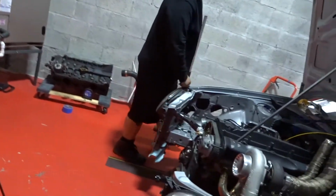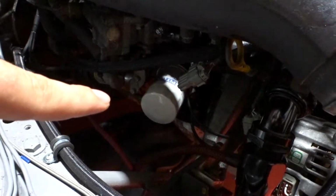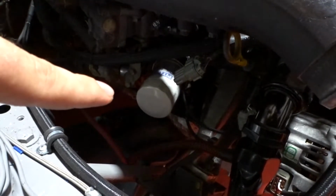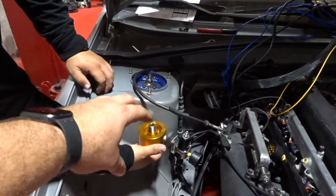In the last episode, you can see we have our tubular bumper already painted and it's looking super good. But before we put this in, we need to install our oil cooler and our oil relocation kit. First, we're going to drain all the oil, so we can remove the water cooling system that the RB26 brought from factory. We're going to be running an air cooler radiator with a relocation kit that we'll mount right here on top so we can have easy access to our oil filter.